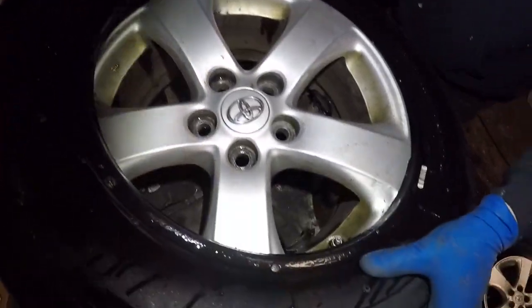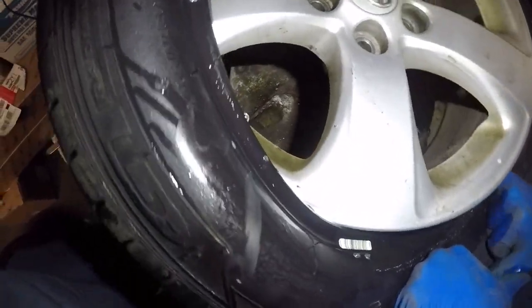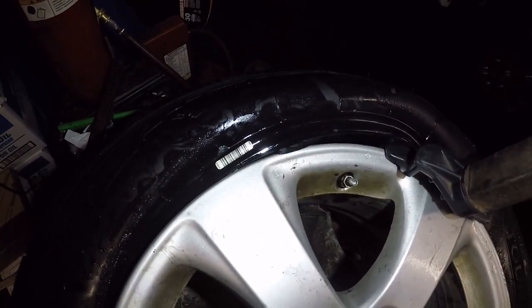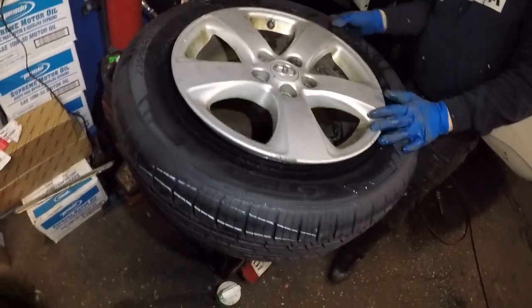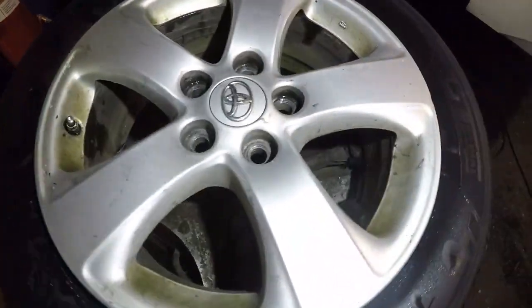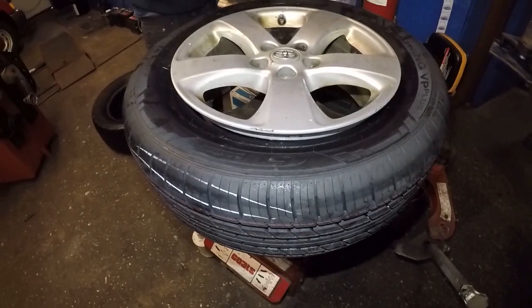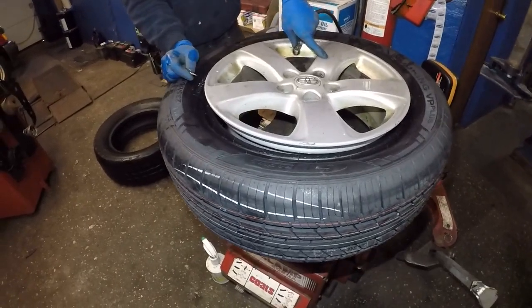We're gonna do the same thing — this time we can't see it because it's on the upper hand, but you can see the two inches and that's the last area that's gonna drop in there. It's gonna sit right where it's supposed to but it's not gonna hit the sensor. That's how you mount and dismount tires with the TPMS sensor. If you have a Lincoln, they might have a sensor right across from the valve, probably strapped inside. If you have any questions you can message me, make sure you subscribe, and now you can inflate the tire.